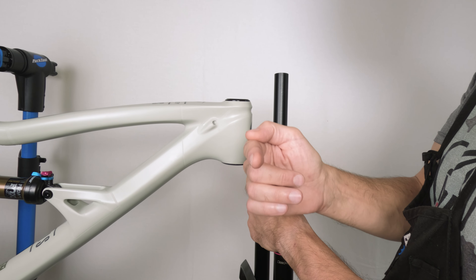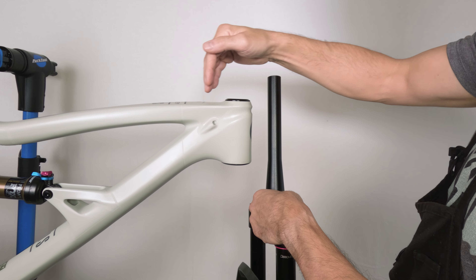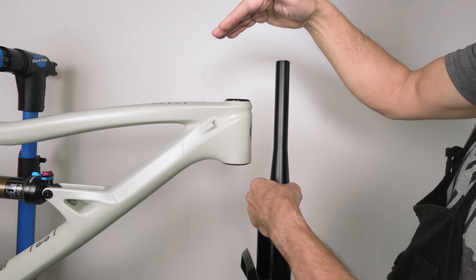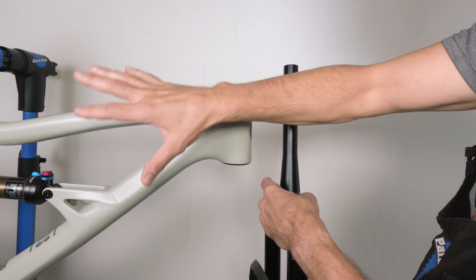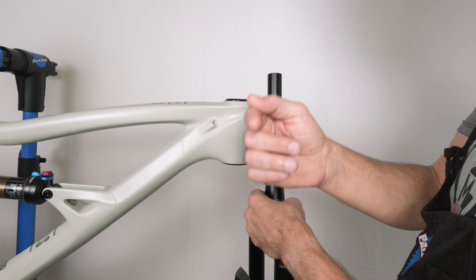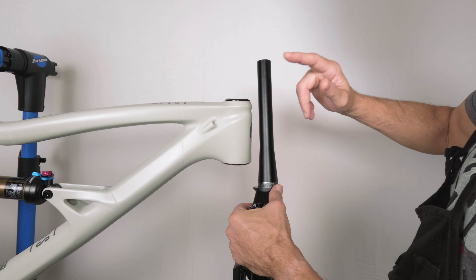Be patient — don't just assume right away. A lot of people buy these new frames and they're like 'oh this is uncomfortable,' because they didn't test different heights of their stem in order to adjust different reach lengths to figure out a setting that makes the most sense. A bike frame is a system and it all works together to create the best setup for you. But you are responsible for putting the time in to figure that out. If you limit yourself to adjustments, you just screwed yourself — that's the number one reason you don't want to cut a headset too short.